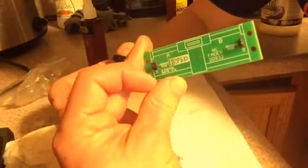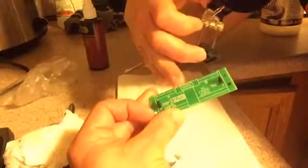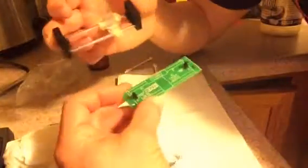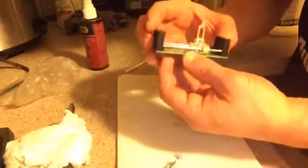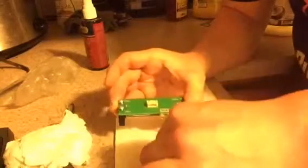So when you're putting this back on to the circuit board, if you look at this little design here, it actually has the design of the fader itself. So you're just gonna match that up. You can see this is supposed to be an outline of this little piece here. So you're just going to match that up and put it back on so you don't put it on backwards. So you'll put it on here like so. Once again, be careful with those little sensors there. Then you're going to hold it, match up those holes, and put the screws back on. And just like this.